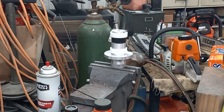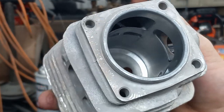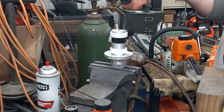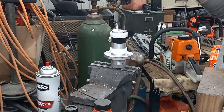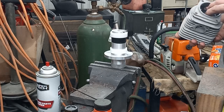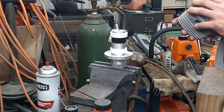I went right ahead and did the first cut on the CS8000 here. I took about 40 out flat-wise, but I'm not done. I'm going to go to one of my other methods, cut the piston, and then cut the chamber on an angle as well for this particular build.